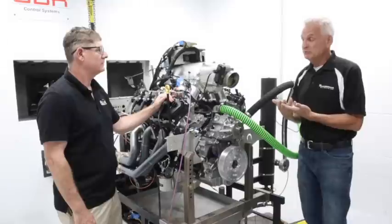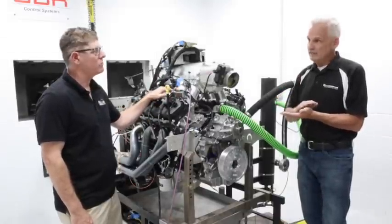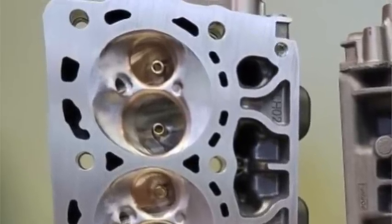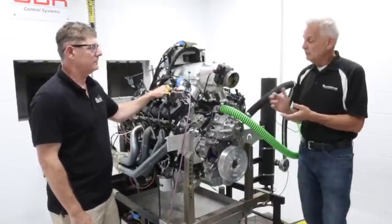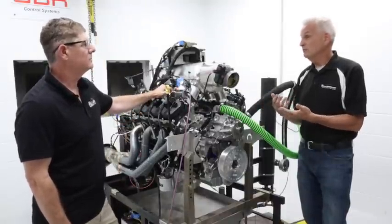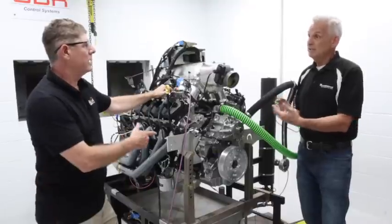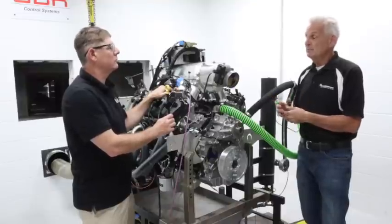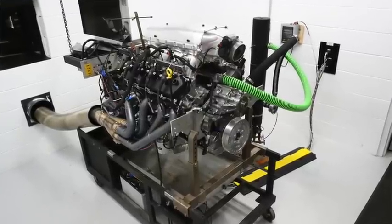The thing I'm really optimistic about is that if we tried to do an engine for maximum effort NA, it wouldn't have the softened combustion chambers we use with boosted motors to slow the burn rate. We would be up around 15.5 or 16 to one compression ratio, with significantly different cam events. I think 900 horsepower isn't out of the question naturally aspirated — with stock head castings.